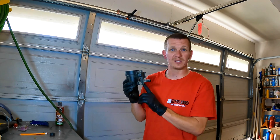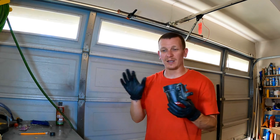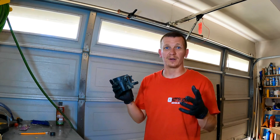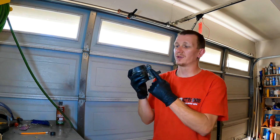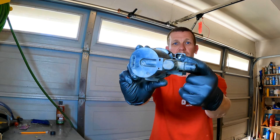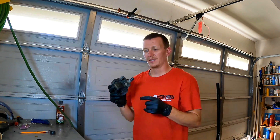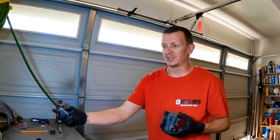This commonly gets plugged. In our situation, we replaced it anyway even though it tested good. This will be the same for almost any other emissions vapor vent solenoid — you can apply voltage to the connector, to those two little prongs inside, and that will shut your solenoid.